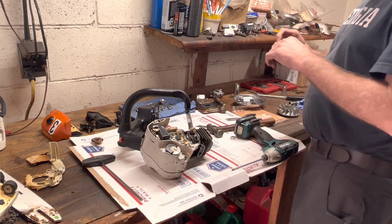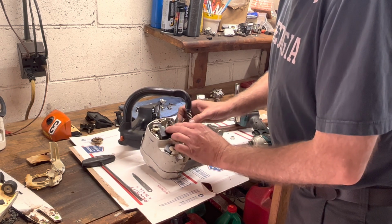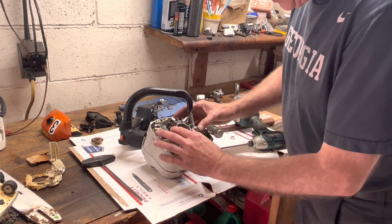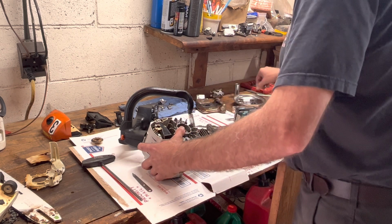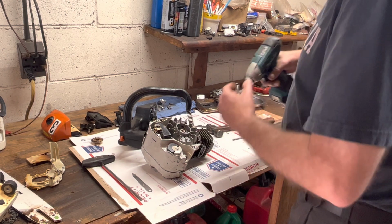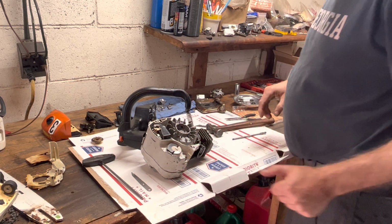I like to use this 10 thousandths feeler gauge for setting my timing, because your air gap is going to dictate, let's get this out of the way, your air gap. And I've also ground a little bit off the keyway, so I'm going to advance this just a whisper. All right. Hold that snug. Make sure that's on there nice and solid.